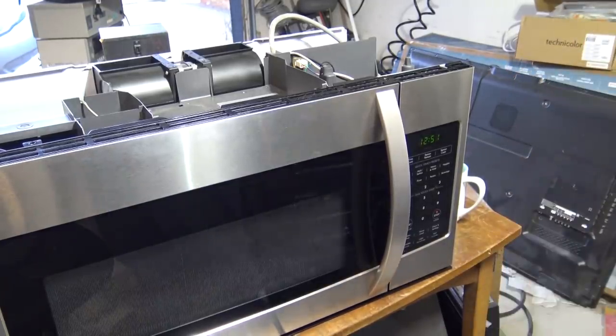Normally when you change these switches, you're going to change both of them - the upper and the lower switch - because when one switch has failed it could have damaged the other one. The owner of this unit just wants to get it working as cheaply as possible because the house is sold and they don't want the new people to move in with the microwave not lit up. But normally you're going to change both the upper switch and the lower switch if either switch has failed because the upper switch could have caused this to fail, or the lower switch could have caused it to fail. The door hook which is not worn on this one - I've changed that before on a model identical to this. Those door hooks do fail and will cause it as well.